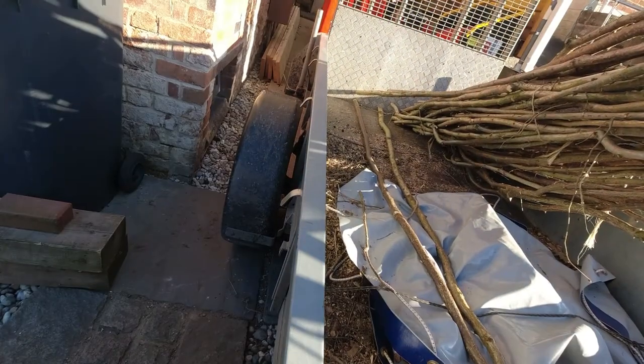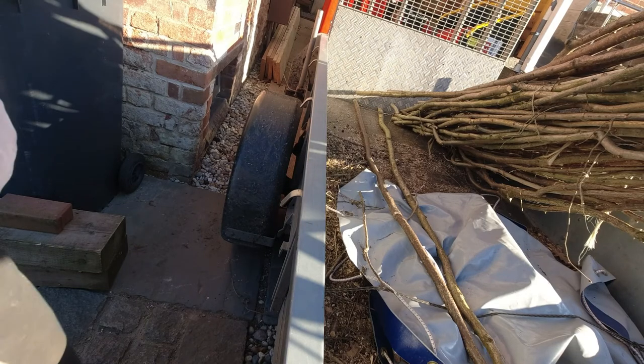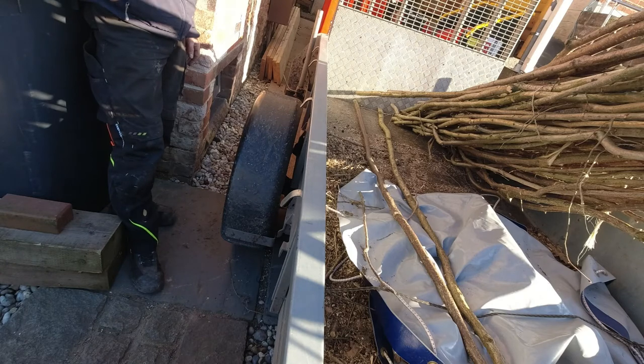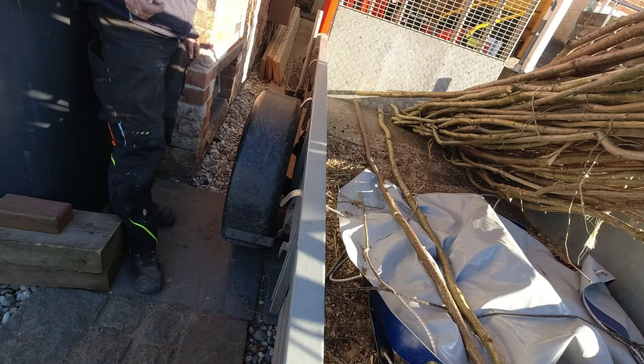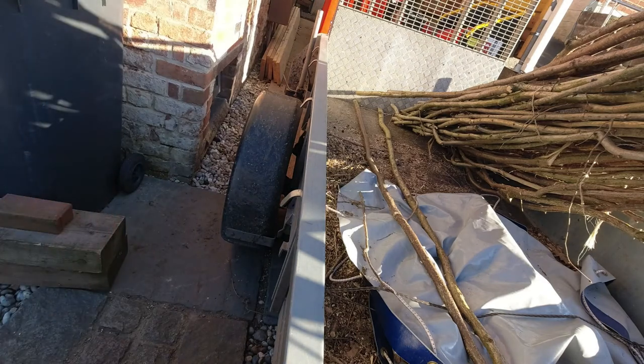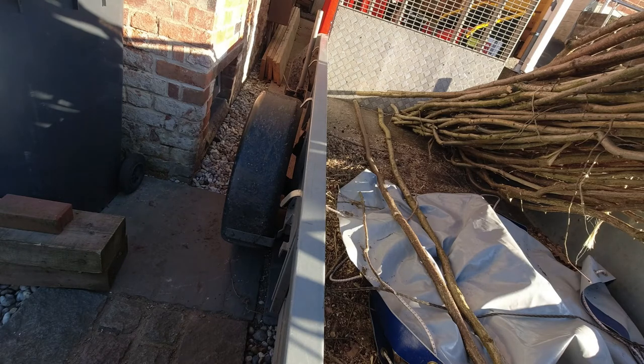Now that seemed relatively painless. The brakes did come on, but that's because I've got a little bit of weight in this trailer. As I draw forward down the hill the brakes come on, but shunt it forward just a couple of inches, release the brake, and it reversed back okay. So that says that I've done everything right. It says couple the trailer, reverse it - if the brakes lock, the brake rod has been over-tightened and readjust the brake rod. So I'm going to say that that is me done.